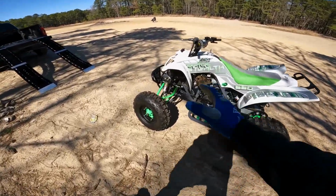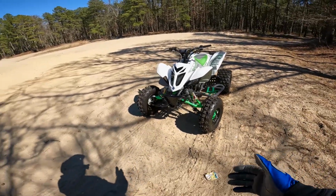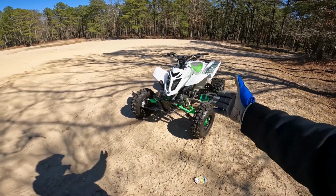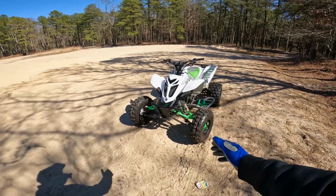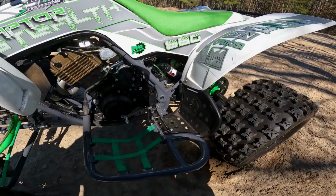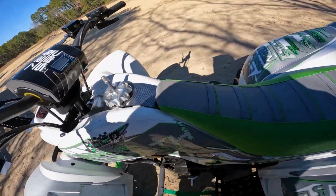They're pretty good tires. In the front, we've got custom extended A-arms made by Full Flight. Lariat Full Flight custom made these. They take the YFZ 450R shocks, and then I had them valved and rebuilt by Rocket Ron. They're all set up for me. The rear shock as well is a dual rate spring built by Rocket Ron Racing. Should be pretty plush.